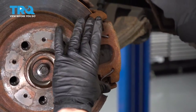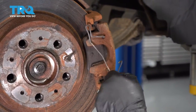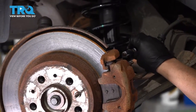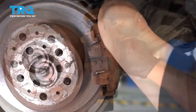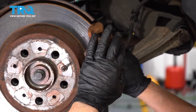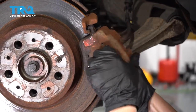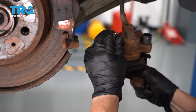Now we're gonna remove the anti-rattle clip spring on this caliper. Just take a pry bar or screwdriver — pretty simple. Now that we've loosened our pins already, we're just gonna slide the actual pins right out of the caliper boots. There's the top one, and then the bottom one. Pull that caliper right out of the way and take the pin all the way out for cleaning.